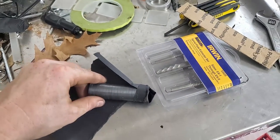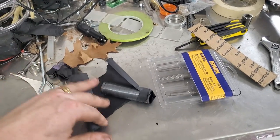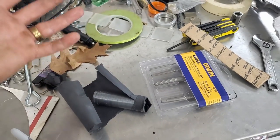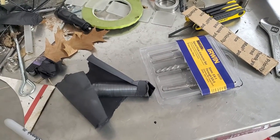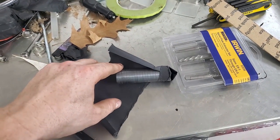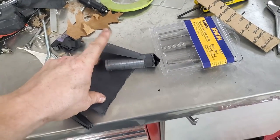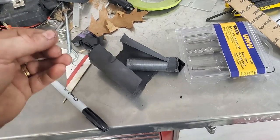I took four or five magnets and placed them on the block around the hole. I originally tried placing one on the drill bit itself, but placing them on the block around the hole worked. As the chips were being blown out from the air pressure, they would stick straight to the magnets — it worked extremely well. And when you add magnets to a cast iron block, it causes the block itself to become magnetized, meaning the shavings are drawn towards both the magnets and the block itself.